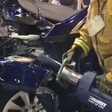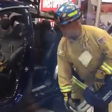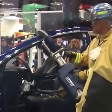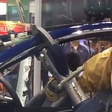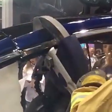From here, Larry's going to move up to the A-pillar in the windshield area of the Model X. There are two curtain airbags in the Tesla Model X. One is located in the A-pillar near the windshield area, with an inflation cylinder close to the dashboard — he's going to check for that cylinder and avoid it with his cut. The second curtain bag deploys up and out of the Falcon Wing door, acting as a curtain airbag, because there's no room in the roof rail to enclose it. A double cut in the A-pillar ensures good movement with no resistance when we push the dashboard. We're cutting through aluminum with a boron rod down the center.